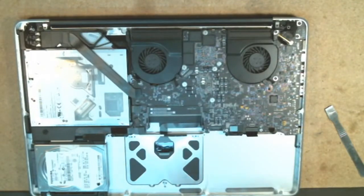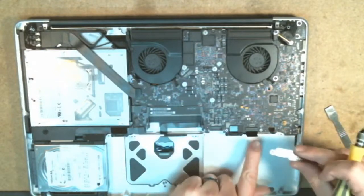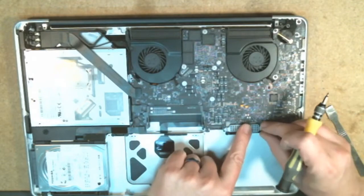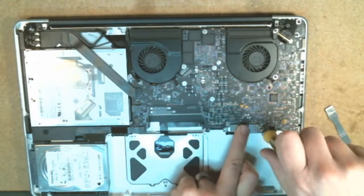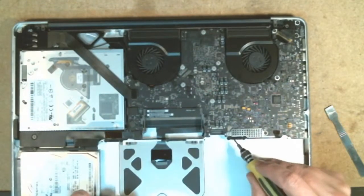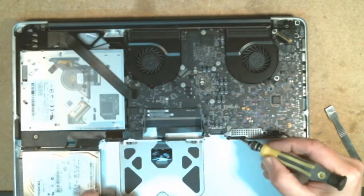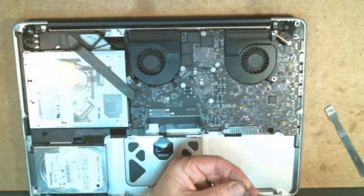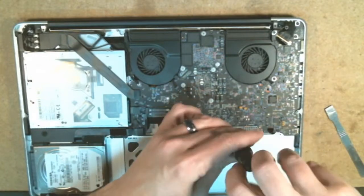Alright, so that's that. Everything is back into place. Oh, here, cable cover right here. Almost slipped by me there. And so we got 2 screws here for that. Go ahead and get your first one locked into place. Now there is also a little black bracket piece. I'm not sure if you can see that right there. Just make sure that the tab that goes down is not on the inside of this. It goes behind it, between that and the logic board. Otherwise it'll be evident when you go to try to push it down. It'll be bulging, sticking out or whatever as far as that goes.